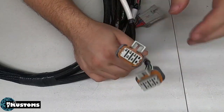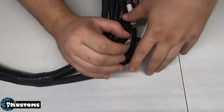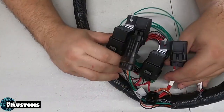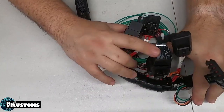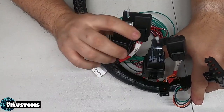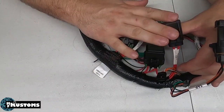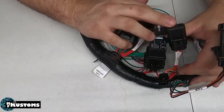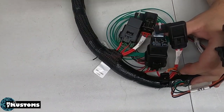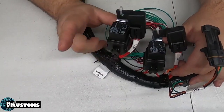The other thing we do, and the reason why we like to fix the injector wiring while we're in here, is the next part, and that is we replace the original coil relay and fuse, and we add a relay and fuse. And these are passenger side and driver side specific. So this way, if your passenger side fuse goes out, you lose your passenger side coils and injectors. This prevents you from hydrolocking the engine if you're racing and just filling it full of fuel when you don't have spark. So the scenario goes for both.